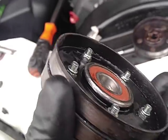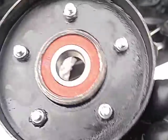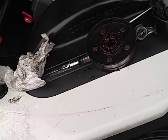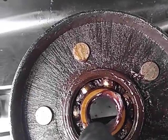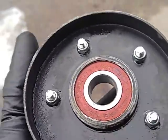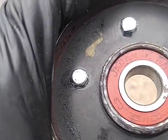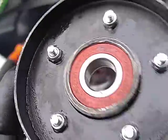My buddy Spike told me that bearing is the same as the GM front alternator bearing used from about 1963 when they went to alternators, on Corvairs through the mid-to-late '80s when they switched to that little alternator with bearings that have nuclear meltdown issues — especially the back one with a needle bearing. The bearing in this housing was really chewed up from the E320, so I put a new Corvair bearing in — a Chevrolet bearing which fits in a Mercedes alternator and a Mercedes idler pulley. At the Corvair show a guy had a bunch made in Canada for three or four dollars each; this one's made in Japan.